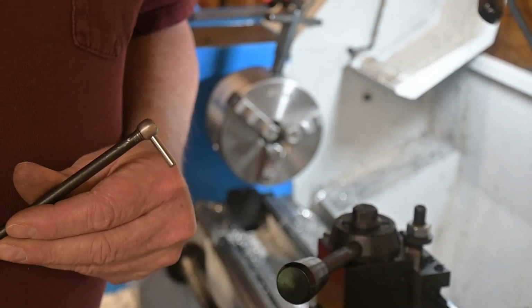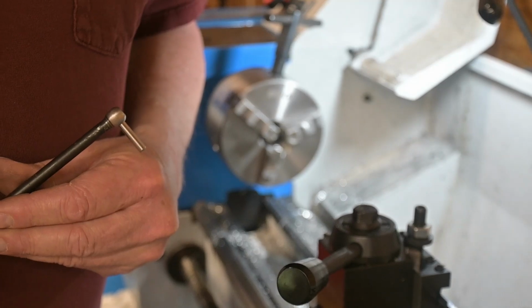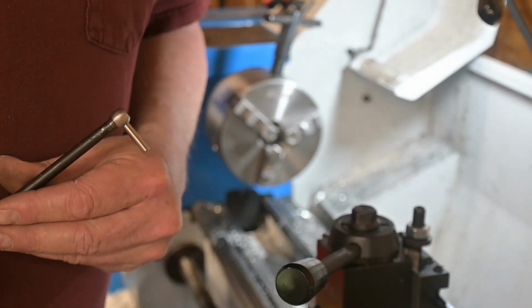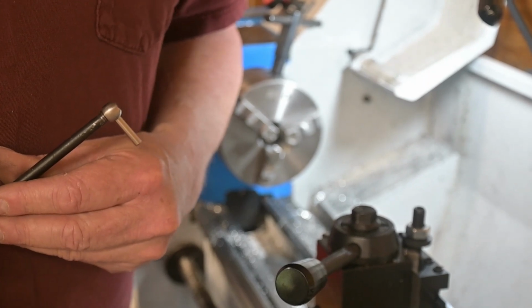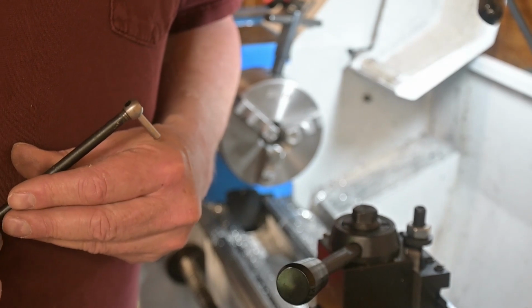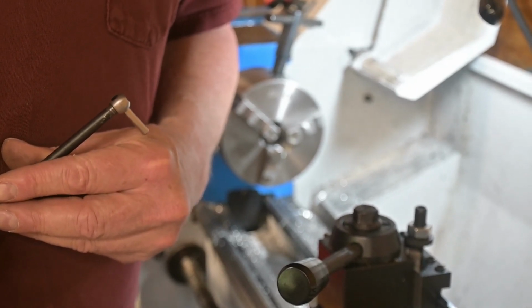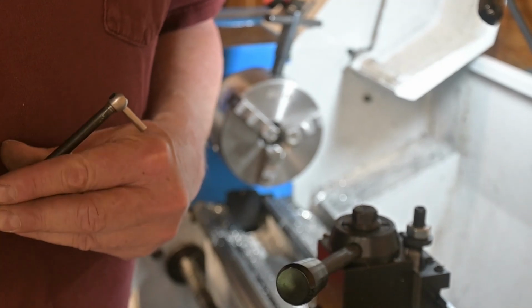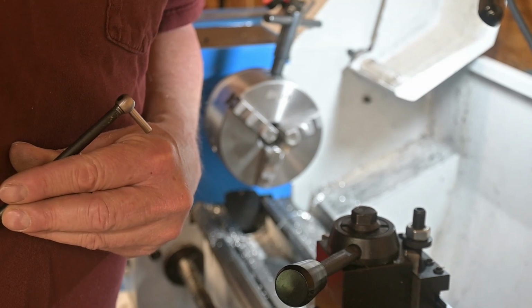So a little change of plans now that I got these things filed down so they'll fit the cups. The pins are going to press in there pretty tight. I wasn't sure if after I pressed them out it would open the hole up a little bit and I'd have to crank them down with the set screw, but I don't have a reamer to make a clearance for this pin, so I'm just going to press these back in, and it should be fine as is. Saves me some time on the lathe drilling and tapping for grub screws.